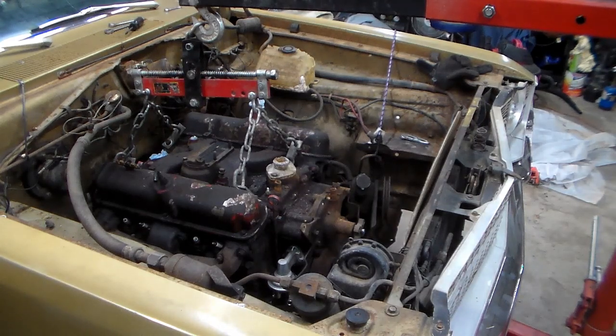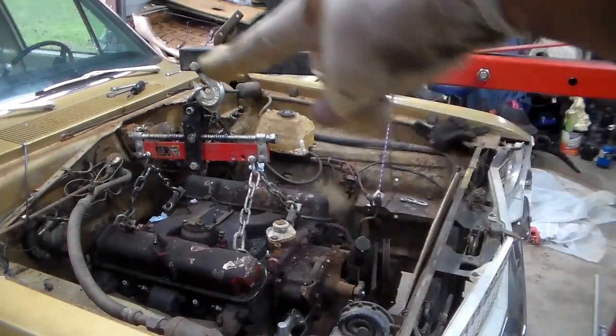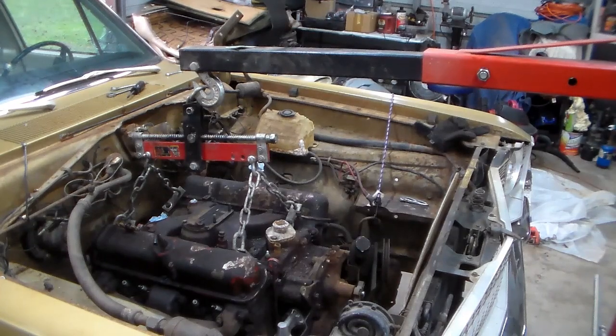So not only do I have to get it up off the engine mounts, but I have to get the engine separated from the transmission. I have the transmission jack under the transmission, so I'm going to have to go around under there several times, I'm sure, to jack that thing up to keep the transmission from falling down and binding the engine up unnecessarily. But I think I have everything: exhaust lines, electrical cables. We'll see if I forgot anything, but I think it's ready. So I'm going to grab one more swig of tea over here, and we're going to get at this.